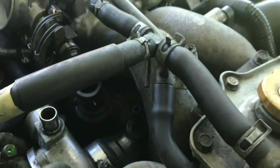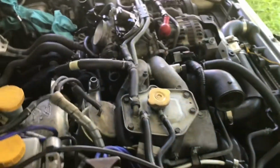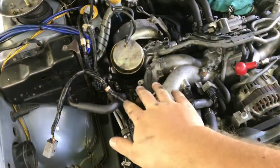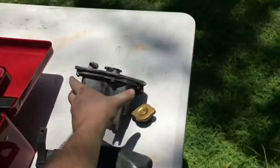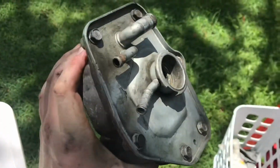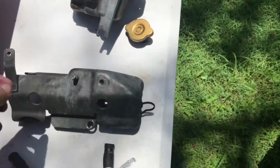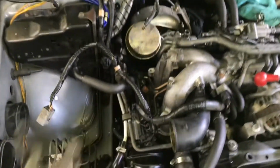Just gotta pop this off, and then I think I'm gonna take this box out to take this cover for the fuel rail off, because there's a hidden bolt for the inlet manifold underneath the fuel rail. This morning I've been focusing on getting the coolant reservoir, sort of like little expansion tank, off, which I've done, so that's off there, with our Mackay radiator cap and all the rest of it. This was the bracket, and this encased the fuel injectors.